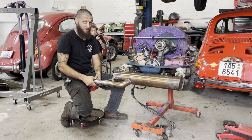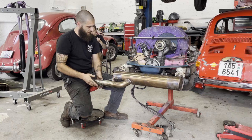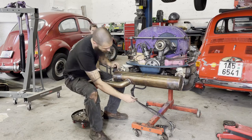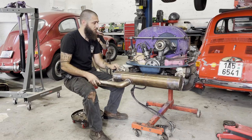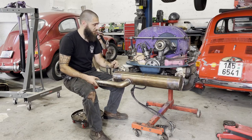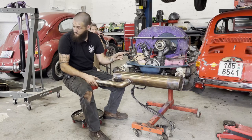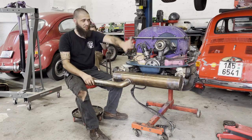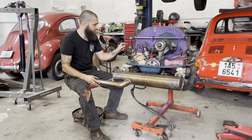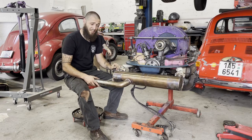I found that I have a vacuum leak somewhere on the carb. I'm getting a new sending unit for oil pressure and another sending unit on the bottom for oil temperature, because it's gonna read more accurately down there than it does up here. I think I'm changing the distributor as well, and then also dress up pulleys. That's gonna be a pain in the ass. I might play with the linkage a little bit, I think.